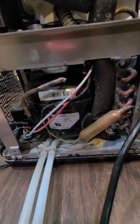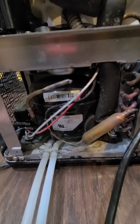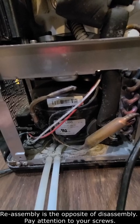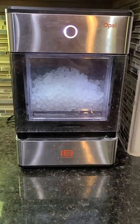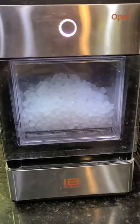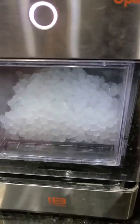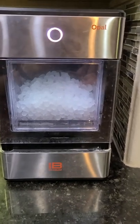Hopefully that fixes this and I no longer have to keep a desk fan next to it to keep it running. It's been running for quite a while now and everything seems to be running great. Flipping the fan over and cleaning that condenser really made a big difference. The air coming out of it is not nearly as hot on either side — it's just a little bit warm versus where it was pretty hot. And as you can see, it's working great.